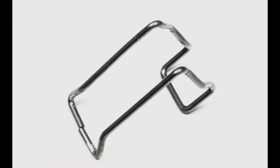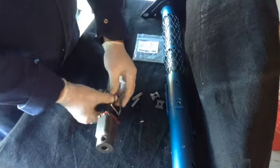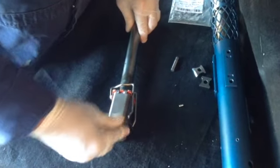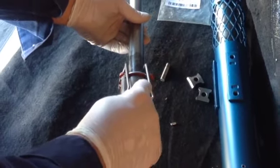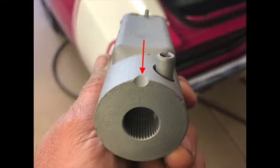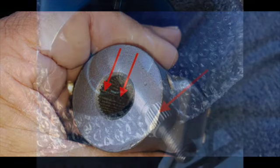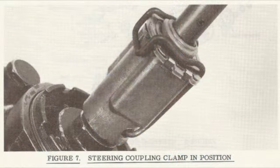I want to thank Alan Erland for a great description of how to rebuild this coupler, located on 4cbodiesonly.com. On some couplers there is a retaining pin that must be pushed in. Put on the steering coupler cover retaining clamp — this was a later Mopar correction. To get the clamp on, spread the legs over the steering shaft. After you attach the coupler to the steering box, push in the roll pin, then put the long legs on the clamp in the roll pin holes. There should be a small V-notch in the outer edge of the coupling, which marks the master spline location inside. This needs to be lined up with the master spline at the steering wheel end of the shaft. When assembling, view the alignment index notch on the shaft to line up with the notch on the coupler.